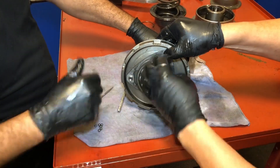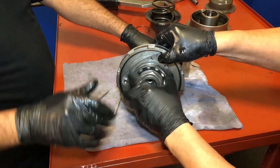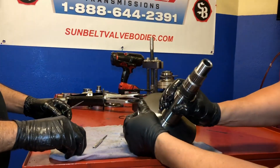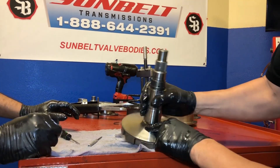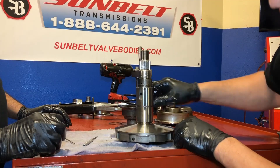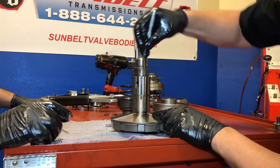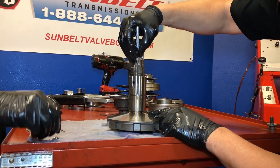You can just hear it rubbing again. Let's look at the shafts here. This one, too, has got a little bit of scarring. You want to buff wheel over it, sand it down a little bit — you're trying to avoid as much damage as you can. Take a look at your shaft too. This is really important. This is where the ball bearings ride. You want to make sure that this isn't wallowed out or worn by the bearings.